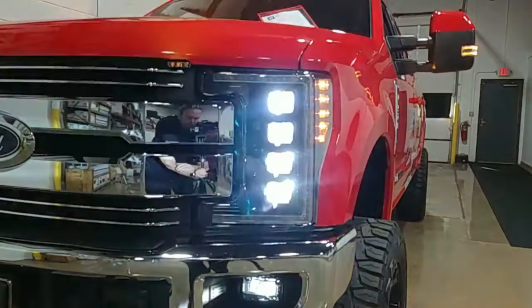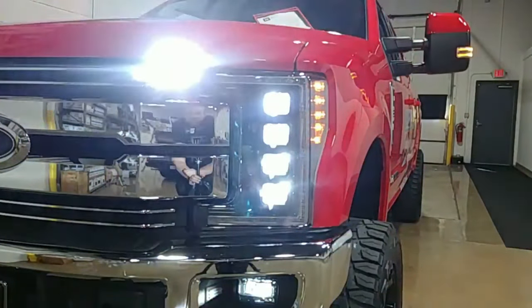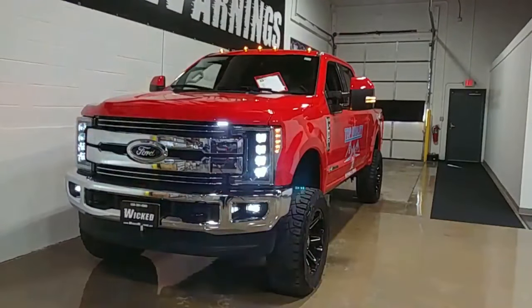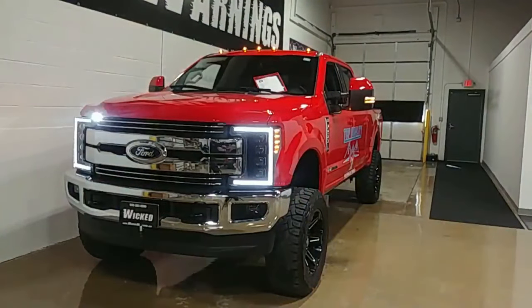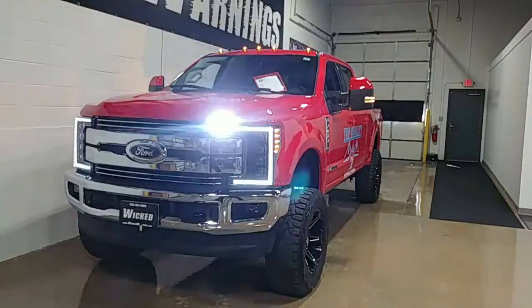I just threw the headlights on to show you what they look like. It's pretty cool the way they use the ring as the turn signal — there's no proper turn signal in the center of the light like the factory used. There are a couple different styles of Morimoto lights, and they also have them for 2020 and up trucks. One thing to mention: our Auto Flasher module normally flashes the C-rings or the DRL. Being that Morimoto has a dual color here and the turn signal input inhibits the DRL, we don't recommend using our Auto Flasher at this time with these headlights. We haven't had enough time to fully test it, so we're not going to promote or recommend it.